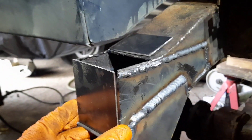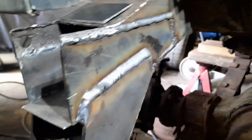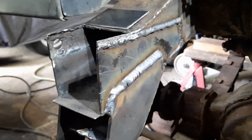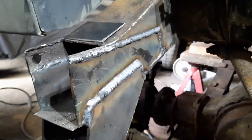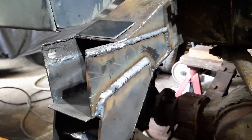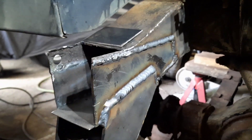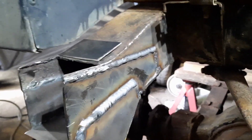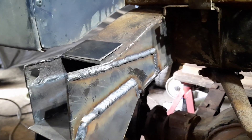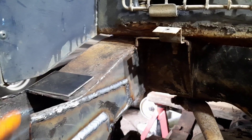We're getting there. I figured when I go to put the bumper on I'll have to re-drill the holes because I've got a galvanised bumper for it but the end's all bent. So I'm going to have to either straighten that or get a new bumper — if I get a new bumper it'll be an aftermarket one so it'll probably want different holes anyway. So I'll leave drilling the bumper holes till last. What I will do is spray some zinc primer up the chassis so that can have a bit of a coating on all the bare metal on the inside before I weld the end on.